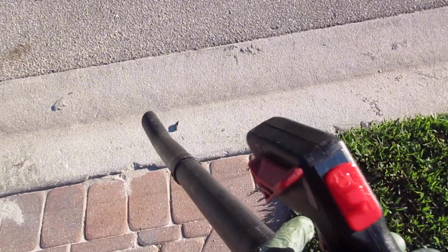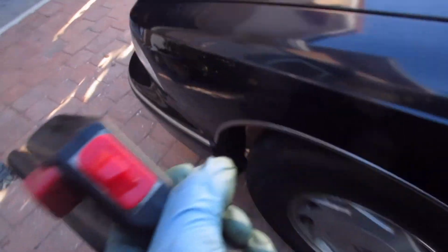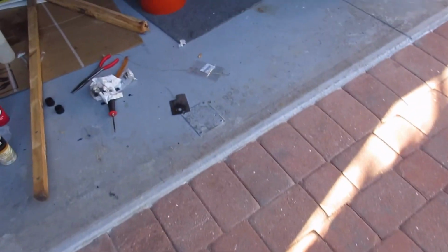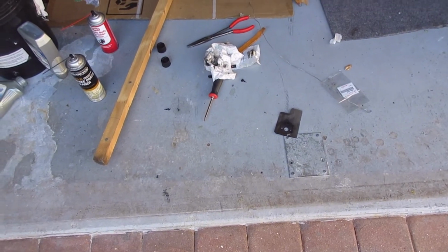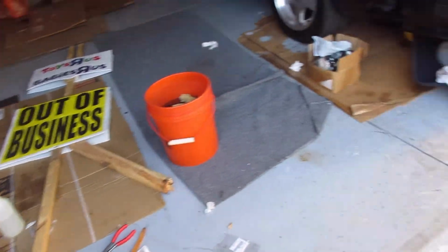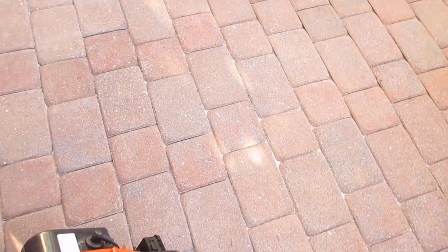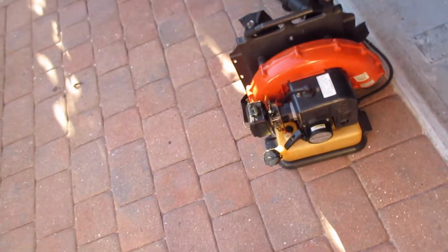And when I goose it, it doesn't bog. Idle's better. That was the issue, dude. The gasket. They've got to be better gasket paper. That doesn't compress as good as the other stuff. Or I can possibly just buy a small gasket, Walbro, made in China. It'll fit those holes. Because I'm not having luck making them myself, and it's not me making the holes. It's just the gasket paper. It doesn't compress.